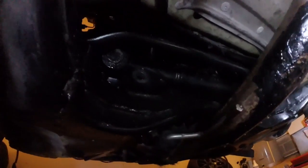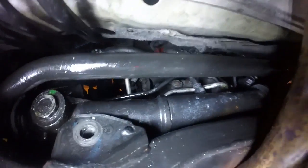My next main thing now is to see if I can come from up top and get this. We got the low pressure line. I want to disconnect that. As you see, since they did it from the bottom, it's pointed at the bottom. So I might have to go from the top so I can disconnect that and snake my arm down. For the most part, that's what we're trying to get at, that low pressure hose. And we're just going to leave that fitting in there because we have a brand new high pressure hose.